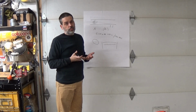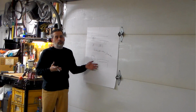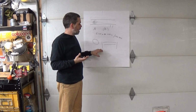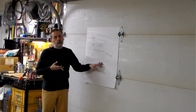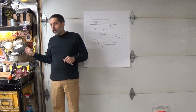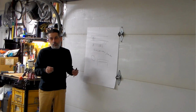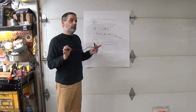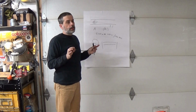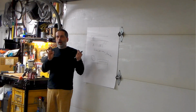And the byproduct of resistance is heat. So if you go with the smaller diameter like that and keep that wire in place, you can actually start a fire, because you're going to build up so much resistance, you're going to build up so much heat, you're going to end up frying that little wire. This is our wire that we cut out of our car here, and again, I think it's like a 12 gauge, it's really small, so you can start running 200 amps in through this wire, and you're going to fry it. So this is why we've got to upgrade our B+ wire to a much